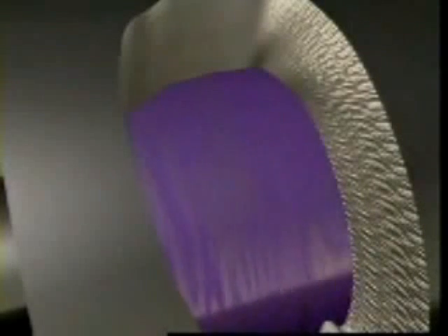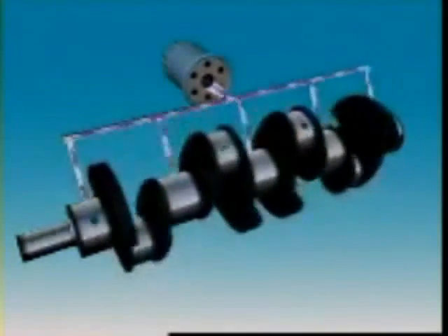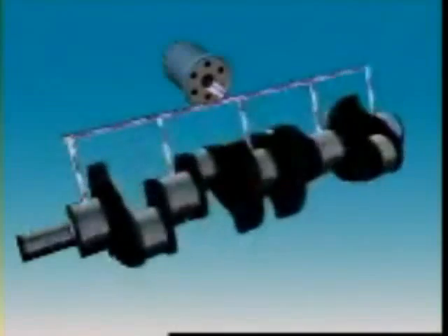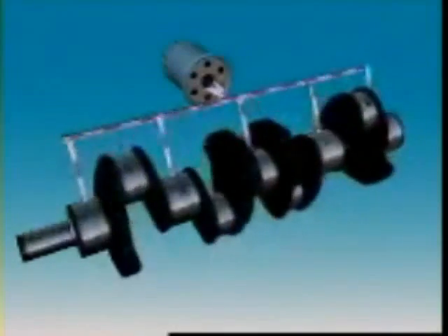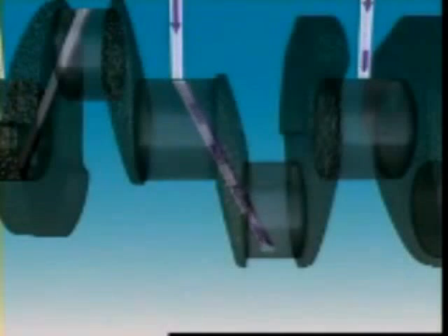Sometimes a mating recess for each side is machined into the cylinder block and mating halves fitted to both. Under normal running conditions, spinning shafts ride on a microscopic wedge of oil. Oil flows through a long gallery in the cylinder block, and each main bearing has its own oil supply passageway from this gallery. Passageways drilled in the crankshaft carry oil from the main bearing journals to rod journals. Oil flow maintains the oil wedge between the shaft and bearing, and carries away particles that could cause wear.